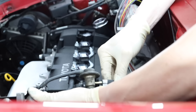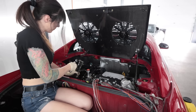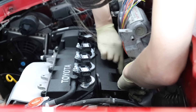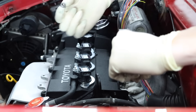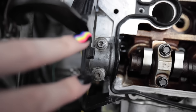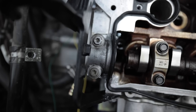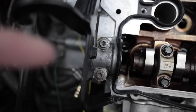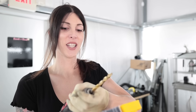These fuel lines look like garbage — I don't know how this car never caught on fire before. I pulled the valve cover because I have to put the cam trigger in, and to do that I have to have the cam cap off. Problem is the hardware on the cam cap is not coming out. These are two TP27 Torx bits and they are seized. They do not want to come out — they're not stripped yet, but bad things are going to start happening.